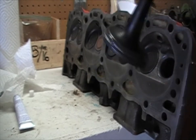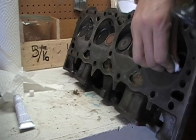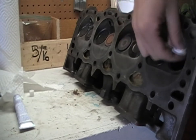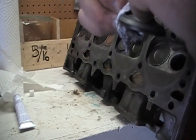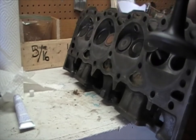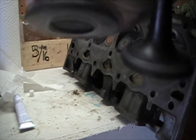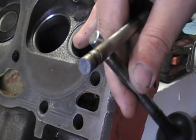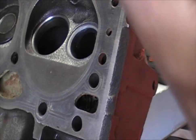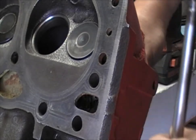You are going to notice this is kind of a milky substance that the compound turns into. You are going to want to wipe that out of here — you don't want that getting down into your intake manifold or anything like that because it can actually start to eat away. Then wipe this down. Grab the next valve over so you can see the difference: there is a white line now on the one we just did. That means that the valve has been seated. When you set it back in, you will notice it has a lot more resistance because you have formed a seat.